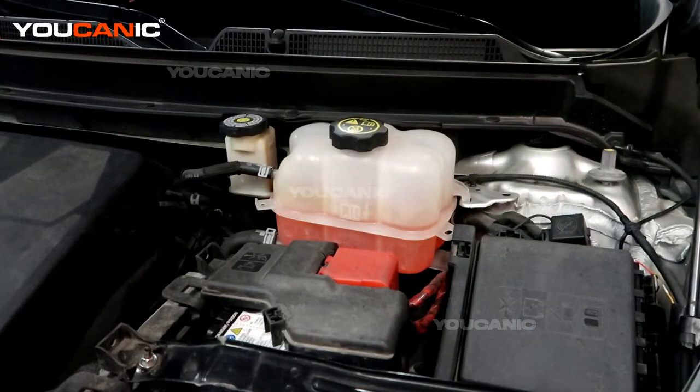It's highly recommended you either buy the pre-mix 50-50 mix, and if you do mix your own because you bought a concentrate, it is a more economical way. Make sure you use distilled water as you mix it, because it's better for the engine, and also because the minerals in your regular tap water will cause issues with heater cores and other radiators. So you always want to be putting distilled water and really just putting antifreeze as a 50-50 mix.